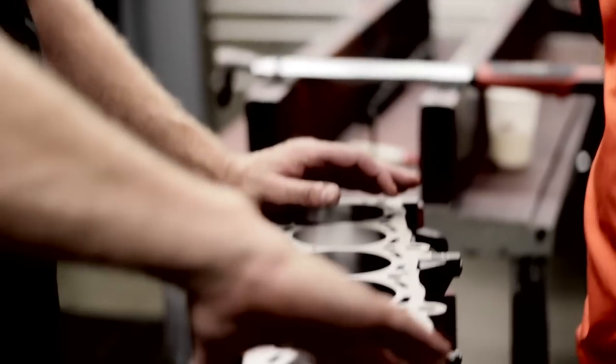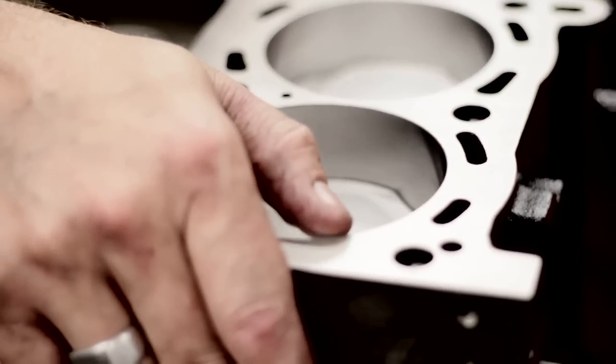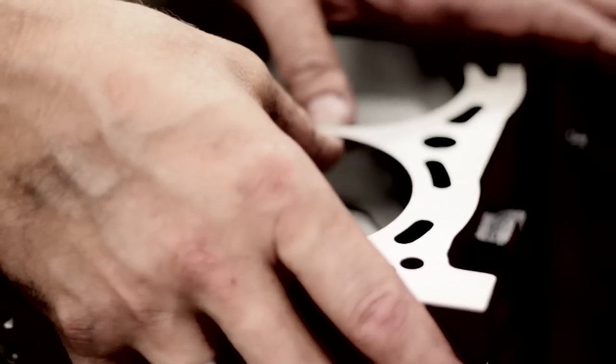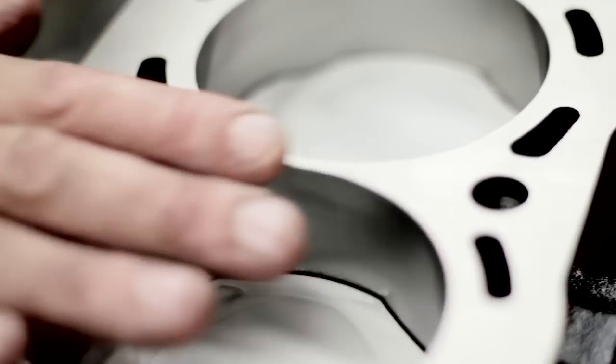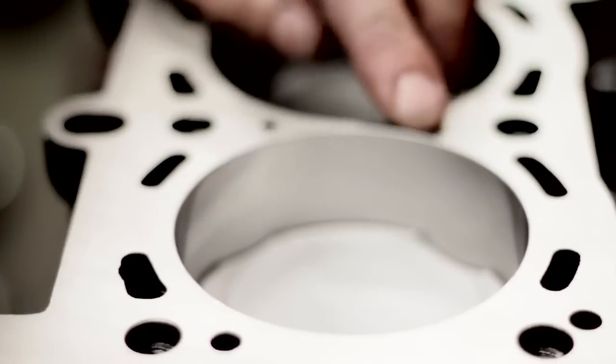When you were putting these pistons in, I noticed you were having a little issue getting the piston in the cylinder bore — what was that from? I'm running a couple different styles of ring compressors to collapse the rings around the piston to knock it into the bore. The issue is I'm not running a lot of chamfer on the cylinder itself. The block has been surfaced and bored, so you get a real sharp edge on the cylinder wall. I can't put a large 45-degree chamfer on because look how close these cylinders are married together. That's where the head needs to clamp on and seal between these two siamesed bores — you're talking 100 mil, very thin, to get the head gasket to hold.